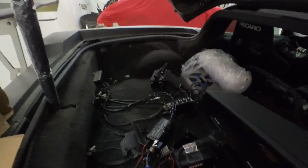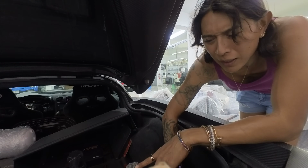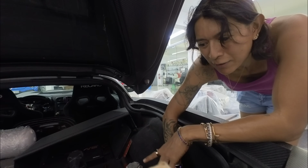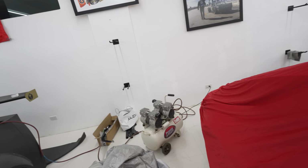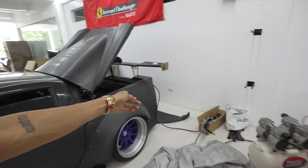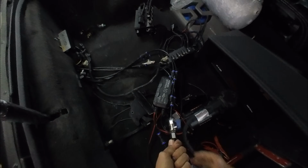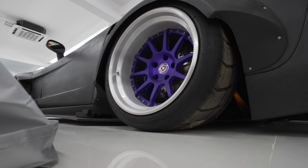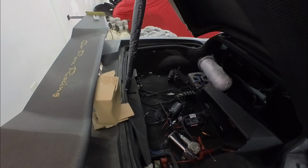I don't feel like it's raising up. This might take a really long while because normally when you air up a car, you have 140 to 160 psi of pressure. We're not building any pressure now, we're just directly pumping into the bags, which means it might not even hold. That idea wasn't working, we're now trying a second idea. I basically need to find a way to connect this system. I did feel the car go up just a tiny bit. How on earth are we gonna do this?